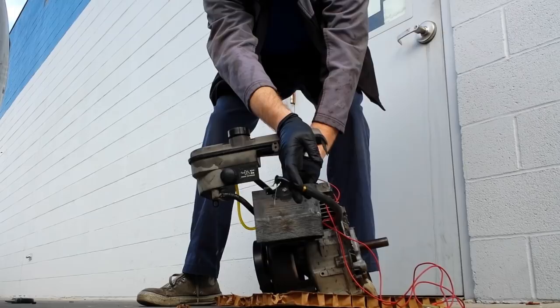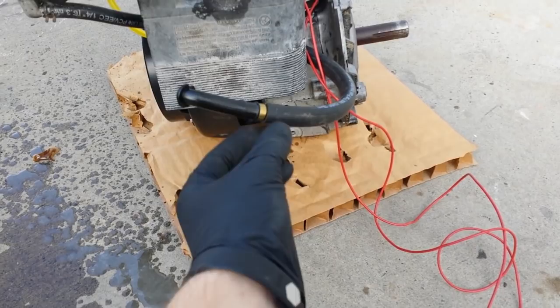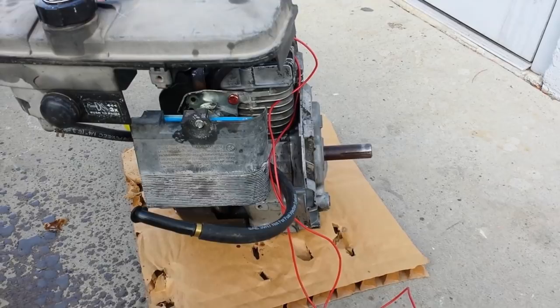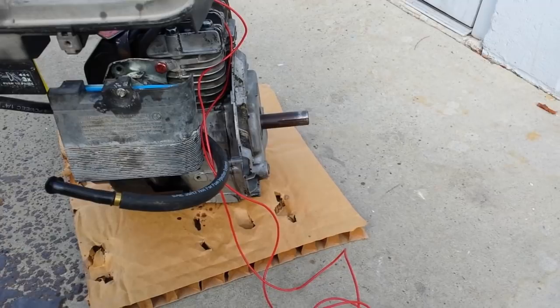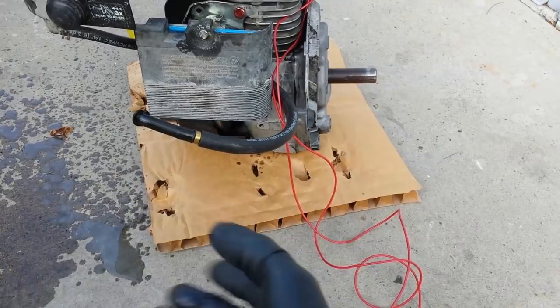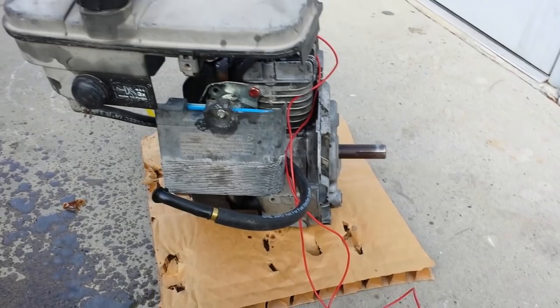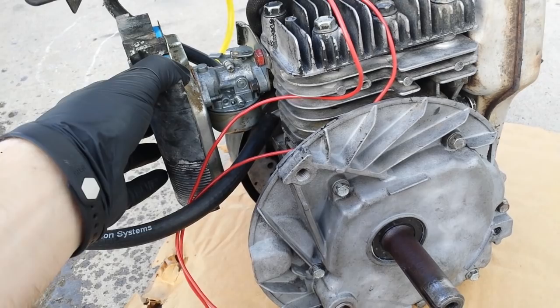You can see where I had it running a little bit earlier — look at all that oil puking out of the crankcase. I'm thinking that hole I drilled in the valve spring compartment was maybe a little bit too big. Compression is kind of low on this engine — by kind of low I mean 40 psi, so pretty low. It could be a lot of blow-by getting past the rings and causing that. The air filter housing did bolt onto the carburetor just fine, so that's nothing to worry about converting to this setup.